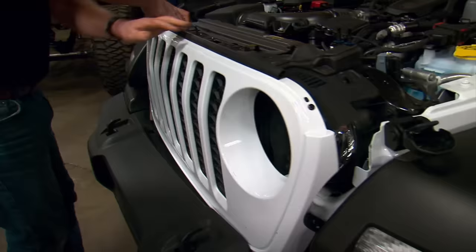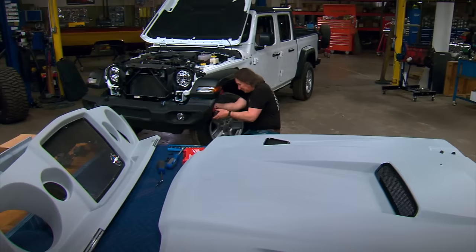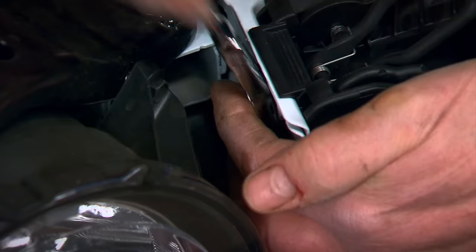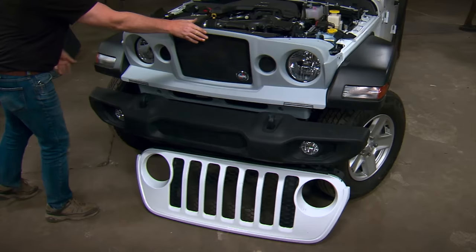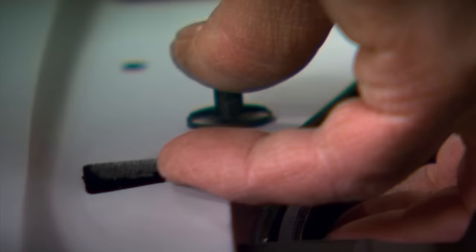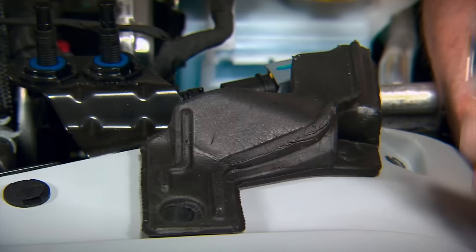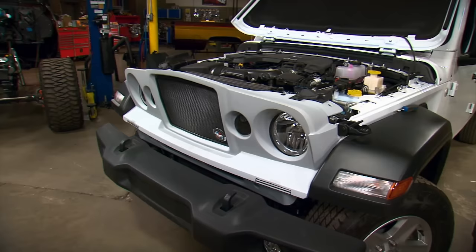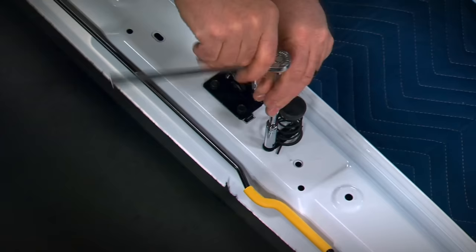The stock grille just pops off and once again reminds us how cheap and flimsy it is. We'll also remove the lower bumper plastic filler panels and finally the lower hood latches. The new fiberglass nose section looks so different you'd swear there's no way it's going to fit in the stock location, but Innovative did a fantastic job utilizing the stock mounting points — it just slides in place and fastens with the original fasteners. The sides slide right up to the original fenders and bolt on, making this look like a factory original part. Notice how the gaps are gone and everything fits nice around the fenders and lights.